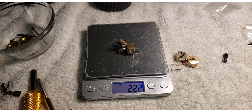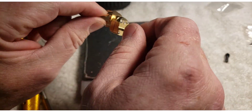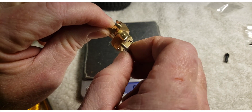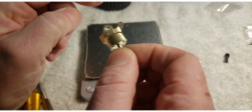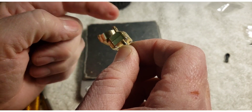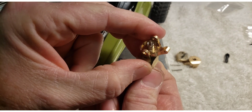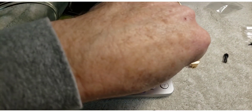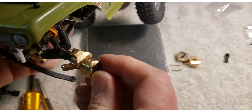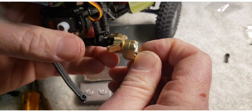The original non-portal piece weighs 9.6 grams; the portal assembly comes in at 22 grams assembled. I put a little bit of three-in-one oil in there — I really like that, it makes the gears track beautifully. At this scale it's so smooth; it doesn't even have bearings but it doesn't need them — it's unbelievably well machined. Bearings would just get plugged up eventually. When bolting it together, make sure your geometry lines up with the piece you took off. I do one side at a time so I don't get confused.